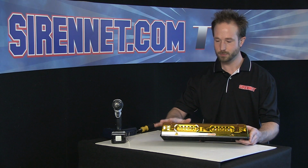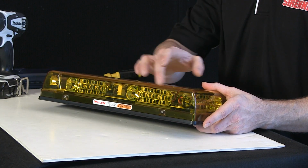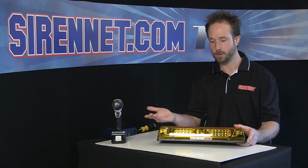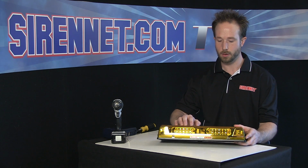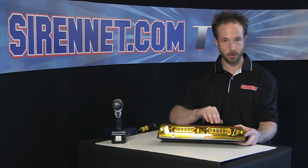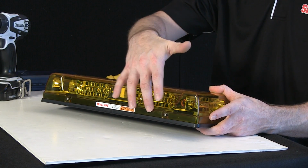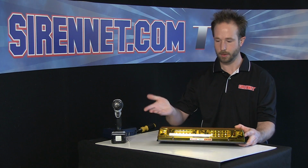It's really linear for the mini bar aspect of it versus using some other different styles of light heads that Whelen does have in different mini bars. So you have what's almost equivalent inside the bar here to a 6-diode linear head that you find in Liberty light bars. Actually, when these things first were produced, the insides were a bit different than what I'm going to show you here, but they did in fact use the same module that was found in the Liberty bar. So if you wanted, you could get one of these, interchange parts from your Liberty. The harness inside was the same, and the module had 3 teeth on the top, 3 on the bottom, and popped into a channel in the bottom and channels in the top of the dome. But that's since gone, and it's been improved in the engineering aspect of how Whelen has the internals.